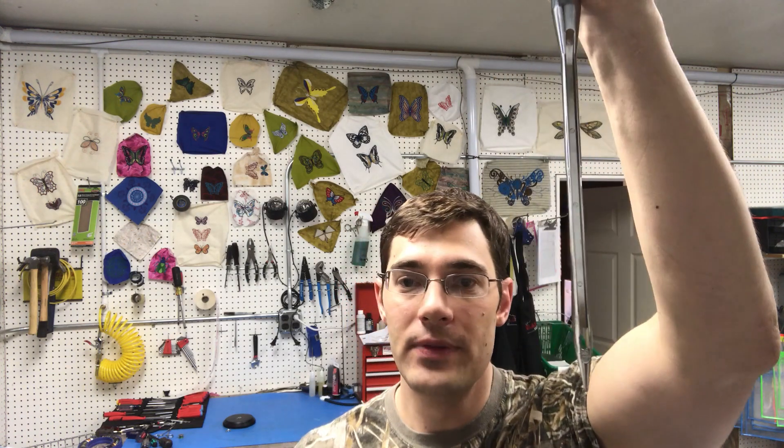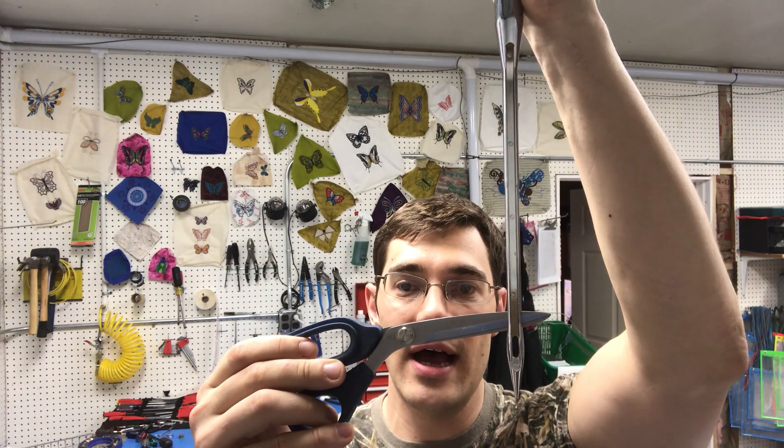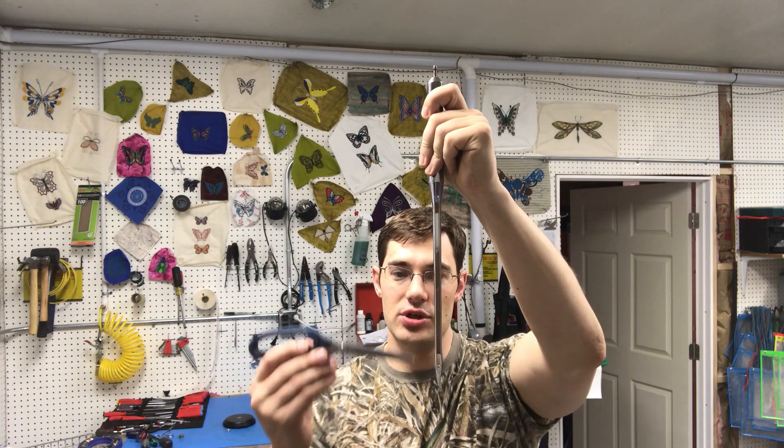If it's a rotary hook machine — like a drop-in bobbin, or the one we're doing in this video — you're going to time it above the eye of the needle on the left-hand side, right above the eye. These are all generalities; service manuals are going to be more specific and give much more accurate measurements. Setting the needle in center needle position with the hook tip usually about half a millimeter above the eye of the needle is pretty standard for most lock stitch sewing machines.